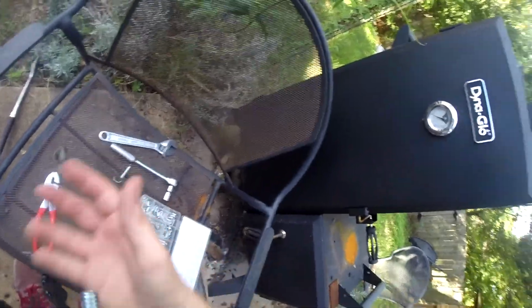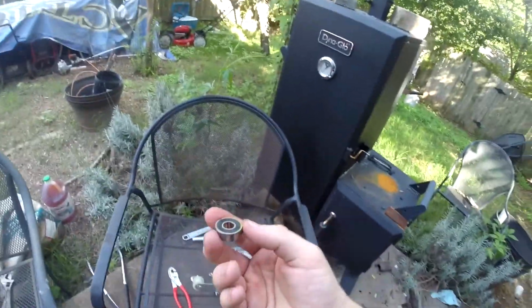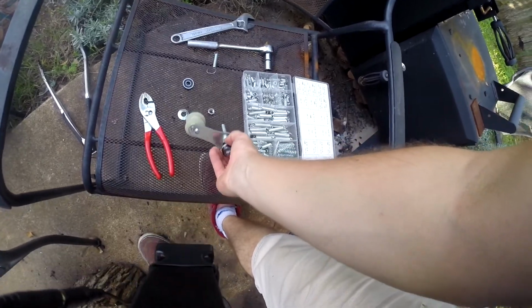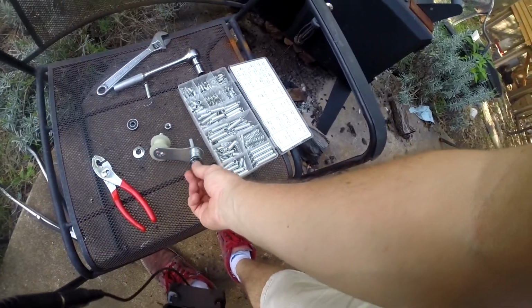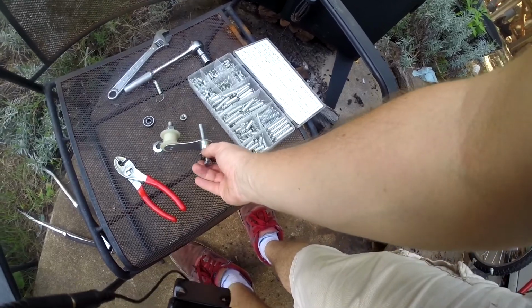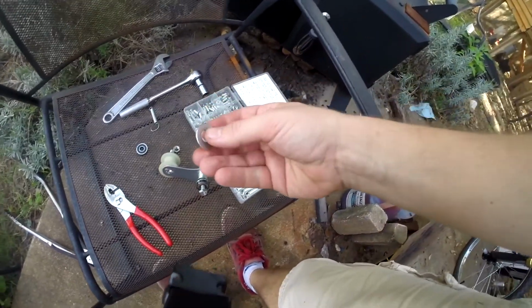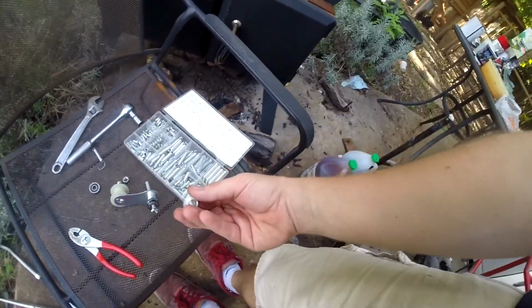So basically what I did, drop the bearing. If you don't drop it, it won't work. Alright, there we go. At one point, these were Bones Swiss skate bearings, which are pretty good. Basically, this is a 5/16-18 threads per inch bolt. It's like 3 inches long, I think, and a skate bearing here. A washer that I've banged the inside of to make it like this, because otherwise it'll touch the inside and the outside of the race and the bearing won't spin.